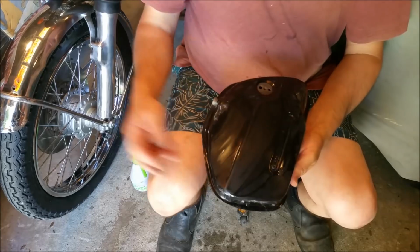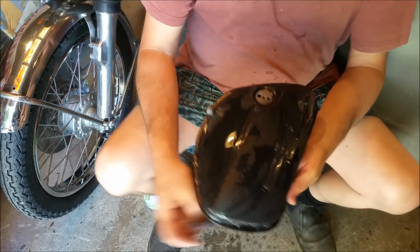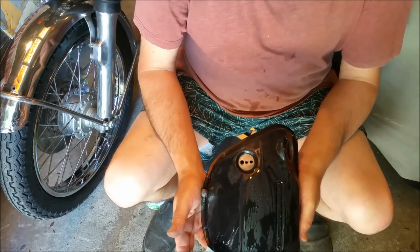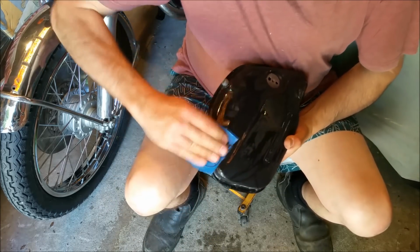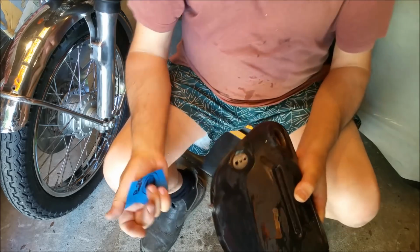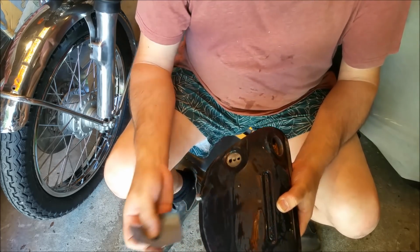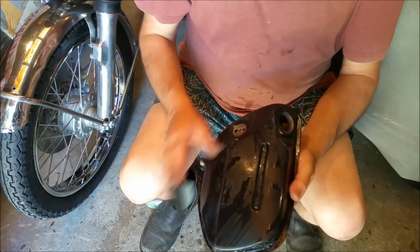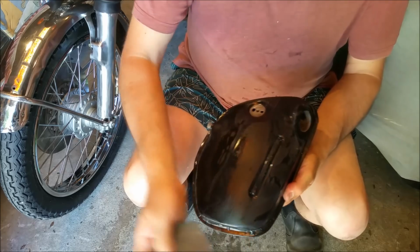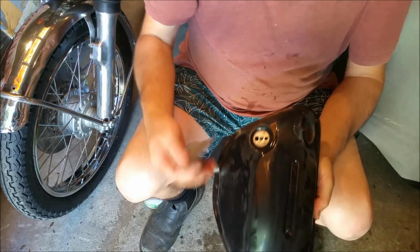What to do? Now, as far as this is concerned, all I did with this, I painted this in satin black, because that's all I had. I didn't want to go and buy more paint. And dusted a coat of clear on, then put 2 wet coats on top. Now I used a retarder in it because it was a warm day. Acrylic doesn't like being laid down in much more than sort of 22, 23 degrees, and it was about 25 or 26 when I did this anyway.